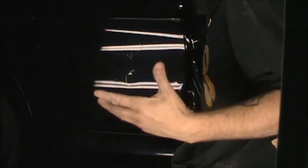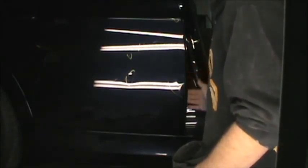Okay, I got the inner structure, and it actually popped most of that dent out when I got that inner structure pushed back. When you're working dents, you're working backwards from the last damage made to the first damage made. By a point of progression, this right here would have been the last thing, because this would have given, and then it would have pushed in, and then it would have pushed this in, right? Follow me so far? So we pushed that out before we did any hammering. I'd say 90% of that dent's gone.